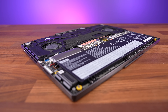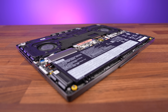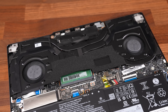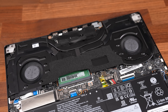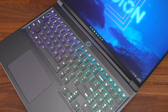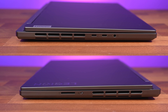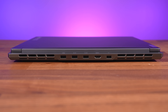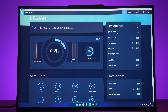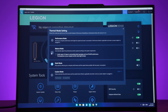Back to the laptop — let's check out thermals. The cooler is bigger compared to last year's version, with an extra heat pipe shared between the CPU and GPU, and a new pipe on the right that wraps around the fan. There are plenty of holes underneath for air intake directly above the fans, and air also comes in through the vents above the keyboard. Air gets exhausted out of the left and right sides and from the corners on the back. Vantage lets you change between performance modes: quiet, balance, performance, and custom.